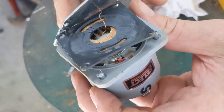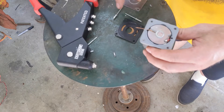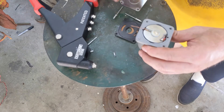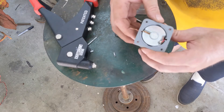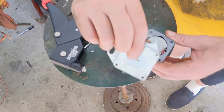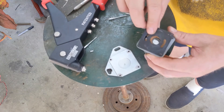Next I'll put this all back together — I'm going to leave this connection maintained here. In the process of removing the rivets, the little wire that was bonded to the case broke off. What I'm going to do is let it exit outside the housing — I'll cut a little notch and let that come out, then connect to it and run a ground to the ground point. I'll attach it to the mounting bracket as a ground; it'll work just as well, maybe more reliably.